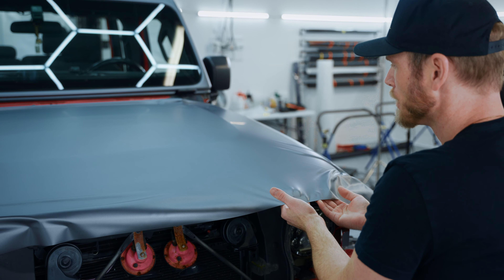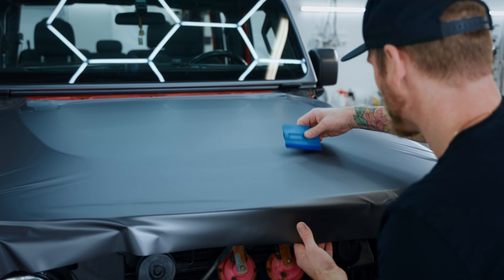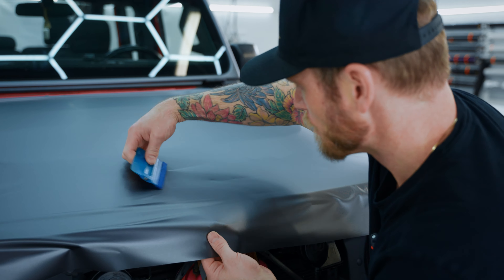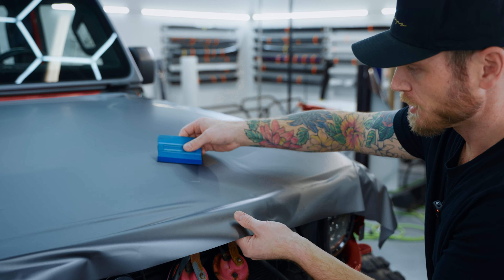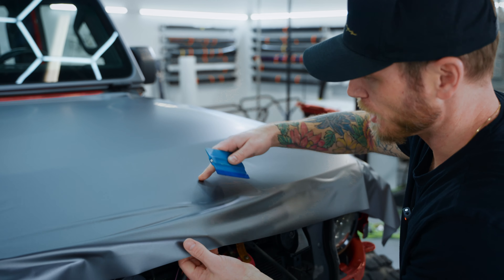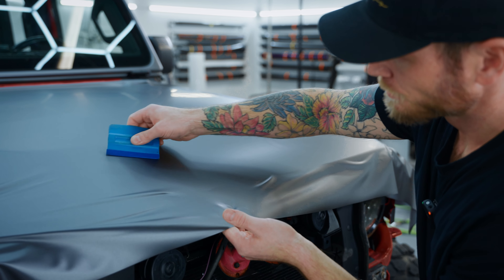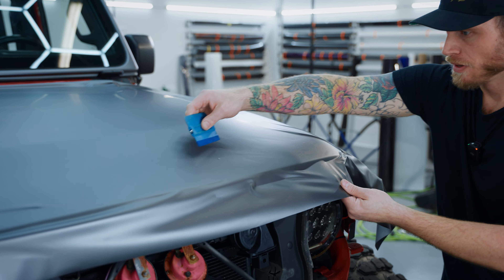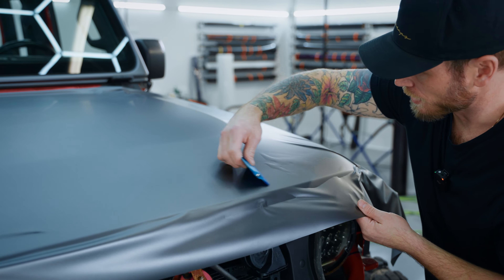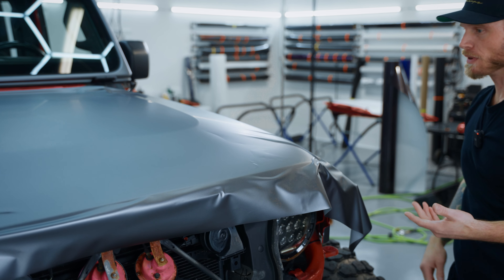You can see I'm just letting it stick to my fingers — I'm not doing anything fancy here. I'm going to work this massive air bubble right here down towards the front. Keep the film elevated if you want — this is going to help tremendously when it comes to squeezing the air out. I'm always trying to work the larger pockets of air towards a section where the air can escape very easily.